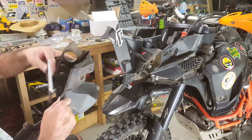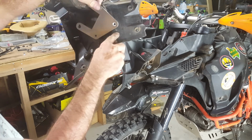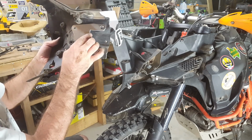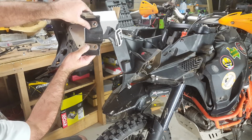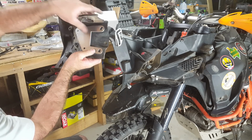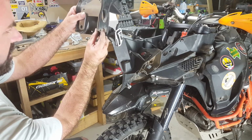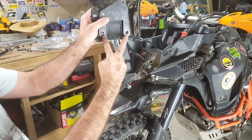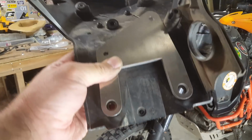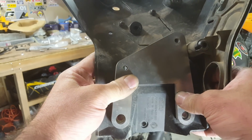Now what you're going to want to do is, this last screw, we need to put a hole in our plastics, which you saw earlier, which I said please ignore. So the easiest way is to line up the 2 spigot holes. You could even put something through there if you like. I'm just going to line that up by eye, and sure enough, can you see that? So what you want to do, line up these 2 spigot holes and then put a mark there and drill a hole through your plastic fairing.